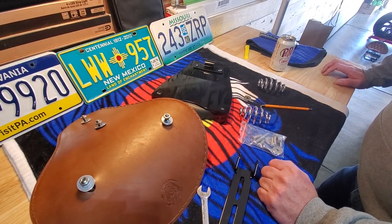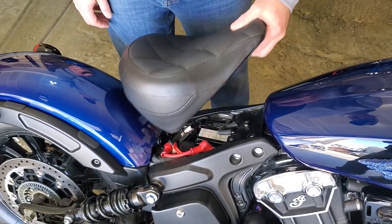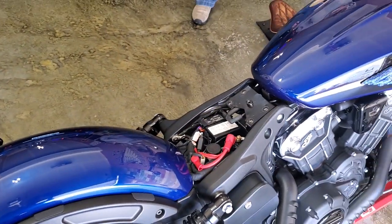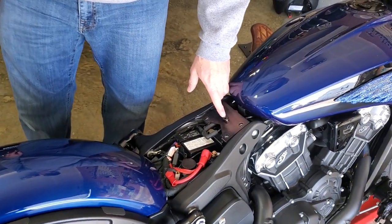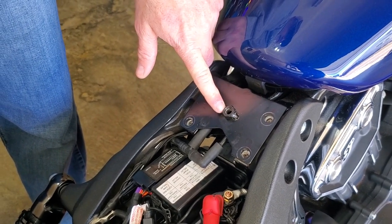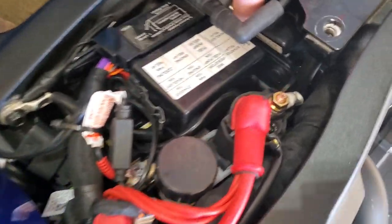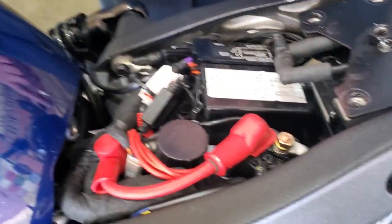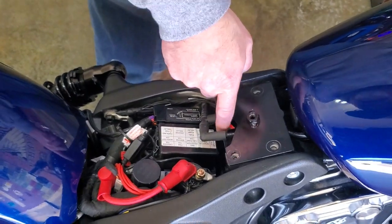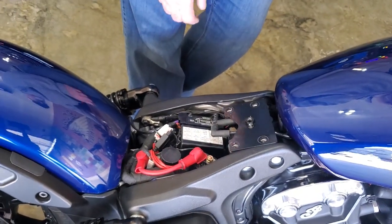So we're going to show you how it goes on the bike. This is a Mustang saddle — I had removed the original stock saddle, because we all know how comfortable it is. I like the all black, but I'm going back to a leather option. There is an aluminum peg that goes in here that you have to remove — it's 13 millimeters. I used a long socket to get it out. If you're impatient like me, it's going to drop down into the battery box — I have mine safely stored below the battery, in case I need it later. So there is storage in this bike: one little bolt storage space way down in there at the bottom of the pan.